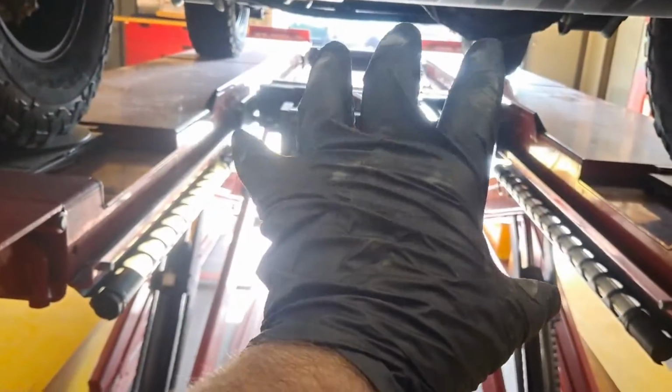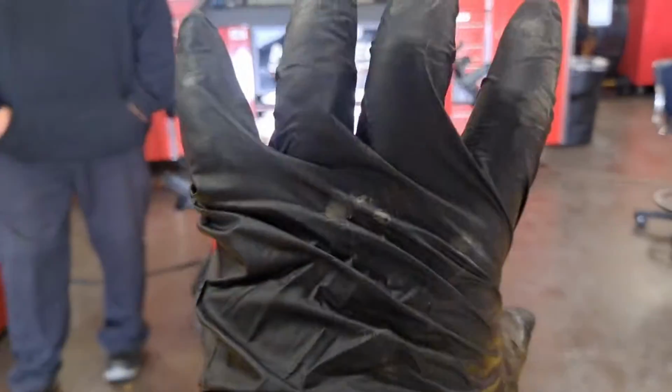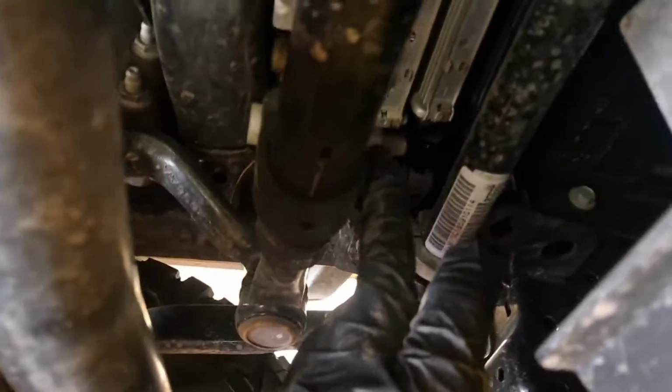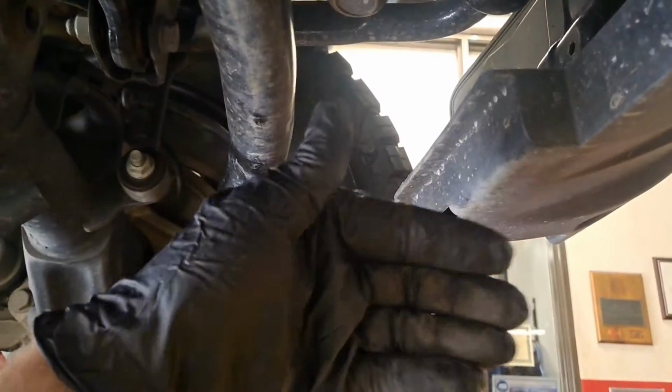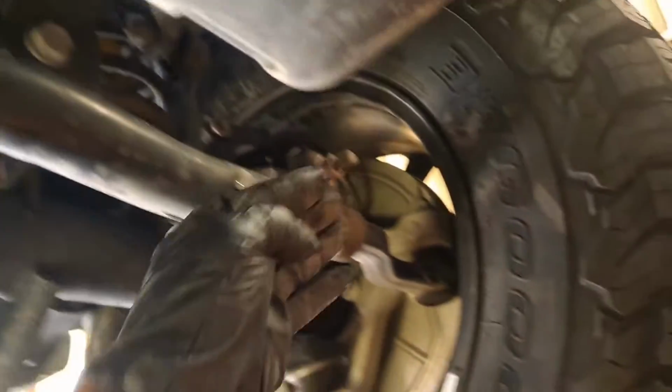If your steering wheel is off center, first you do the total toe. Now if you jump in there and your steering wheel is off center, the way that you're gonna fix that is actually the drag link. So you'd again loosen this clamp. Here's where we were, there's the tie rod. Right over here, there's the drag link. You could loosen that, and then you would turn this, and as you adjust this, it's gonna change the overall direction of both wheels together, because this is your connection from your pitman arm, which comes off your steering box, and it goes to this side knuckle. And this knuckle essentially uses this tie rod to control the other knuckle.